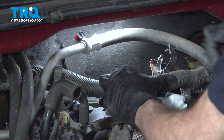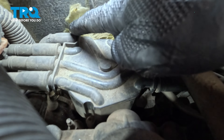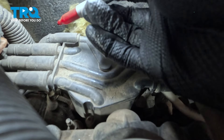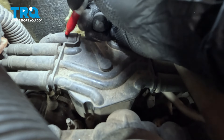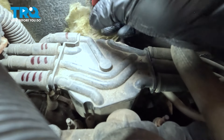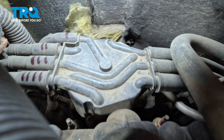Let's have a look along the back side here. You're going to find your distributor cap. On the distributor cap, you'll find that you have seven ignition wires — four along the passenger side and three along the driver's side. Before you start removing any of these wires, it's important to make sure that you mark them. You can use a marker or put some tape on them. Along the passenger side, mark each one: one line, two lines, three lines, four lines moving forward. Do the same on the driver's side — we only have three wires there.